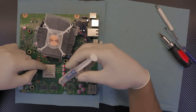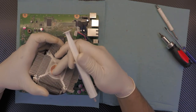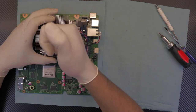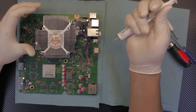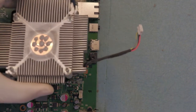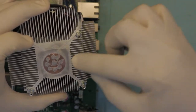For applying, I don't recommend going straight on the GPU surface — it's really big. The most important part of the heat sink is the copper side on the bottom. Try to apply right in the middle of the copper, then put one drop on every corner just like that. That's the way I do my thermal pasting, and I've been doing this for a long time.